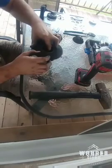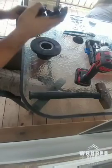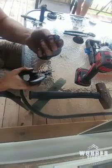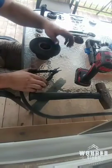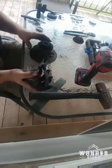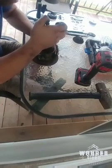Now that we got that out we can get the journal bearing out. Sometimes they'll just come out like that or you may have to persuade it a little bit. This one's in very very good shape - like I said this turbo was not bad. I just had no idea how long it had been sitting in the scrapyard so I decided it was a good idea to rebuild it. You have a journal bearing on the front and back side of the housing, so flip it over, get the other snap ring out, and pull that journal bearing out as well.